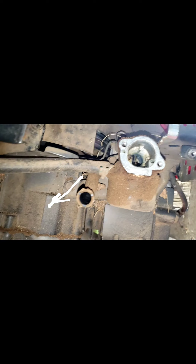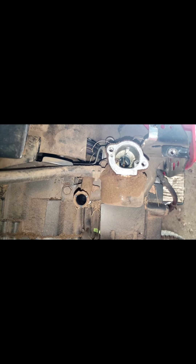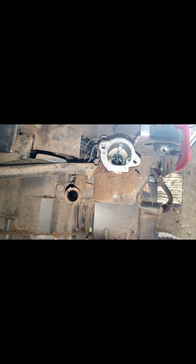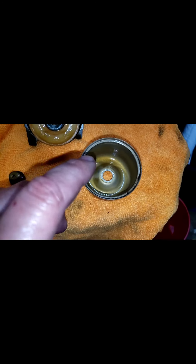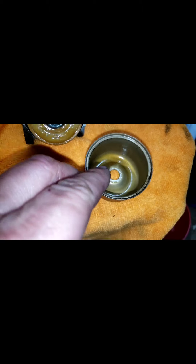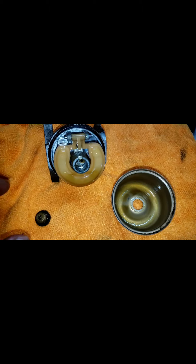It's blowing a lot of dust and dirt. We'll take that off. It does pull over, so we'll take that off and clean the carburetor up real quick. There isn't too much dirt inside this carburetor, but you can tell they are using gas with alcohol in it and leaving it sit for long periods of time.